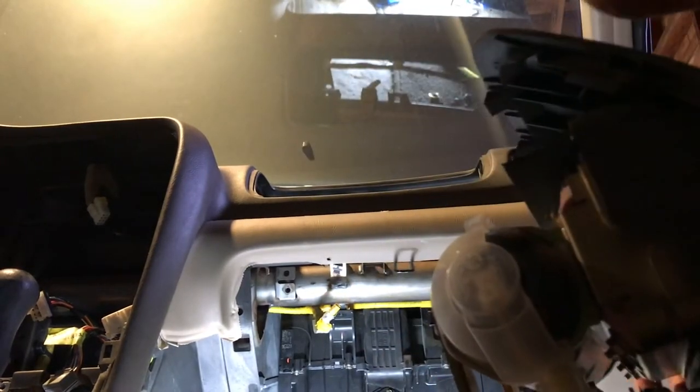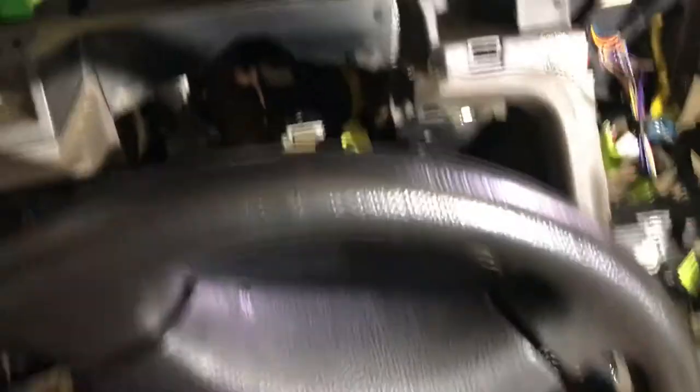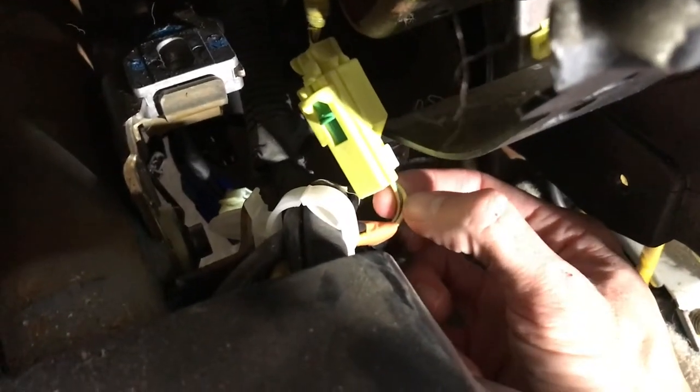Got the airbag out of here finally. Yet another day here — I just dropped the steering column down. Up underneath there are two bolts just holding it up. Once you take those out, the steering wheel will drop down and you can access the dash a little bit better. Once you have the steering wheel dropped down, you should be able to access a few more wires behind the steering column. This yellow one here is another airbag safety clip — I'm just gonna snip that because I don't need it. I'm slowly disconnecting all these dangling ones, trying to get more and more stuff disconnected so I can pull this dash out.